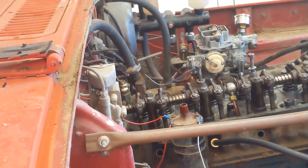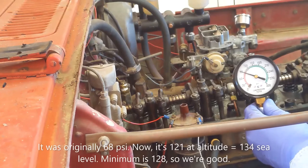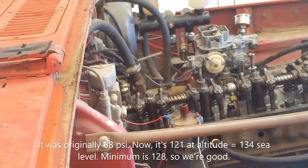I finished the valves and I'm in the middle of the compression test. I thought I would show you the number four cylinder again, because if you go back to the second video, when we first got this car and I started working on it, one of the first things I did was a compression test and everything came back good except the number four cylinder, which was quite low. It occurred to me that maybe the valves were adjusted wrong, so I should do that first before I took the head off. And it's much better than it was — last time it was well under 100 pounds; this time I got just over 120, maybe 121 or 122 pounds.